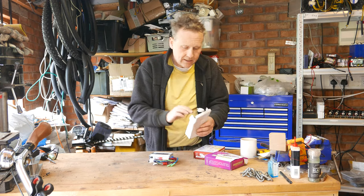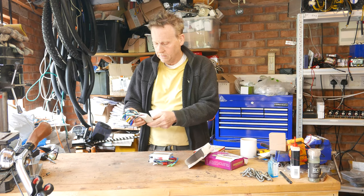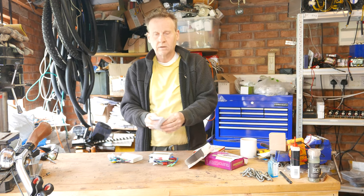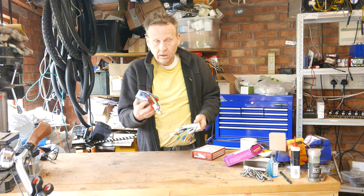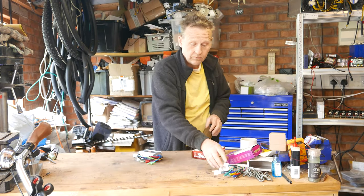There is a dedicated logic analyzer for e-bikes — it's called an electrocar brushless motor controller tester. If you go down the independent mix-and-match route with the e-bike motor and controller, you may want one of these to make sure the hall effect sensors are working at the right time and that all the other inputs from the microcontroller are giving out the signals you require.